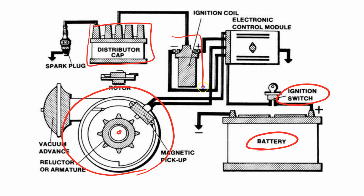We have the ignition coil. In this case, distributor type ignition system, there's only one coil. We also have the electronic control module. This is the brains, and inside the brains, this is where all of the figuring out will be done. And we also have a rotor right here. This rotor sits and is attached to the top of the shaft that comes from the camshaft, and it turns as the camshaft turns, and it distributes spark to each one of the spark plug terminals.